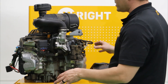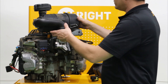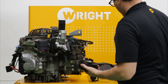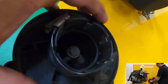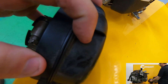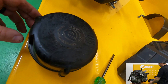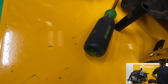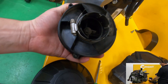We've removed a couple more exterior parts: we took off the other shroud — two bolts — the other coil, again with two bolts, and the fuel pump cover, which was two bolts. I've loosened the air cleaner here. This is the standard air cleaner that Kawasaki uses, but we use a different rain cap. There are little flutes underneath the rain cap, and a piece inside spins, causing all the grit and whatnot to sling out of a little slot. It works very well for dense fines like sand, mineral-type dust, or even grass seed — it all comes shooting out of the slot. As compared to the stock cap, which effectively just keeps the rain out.